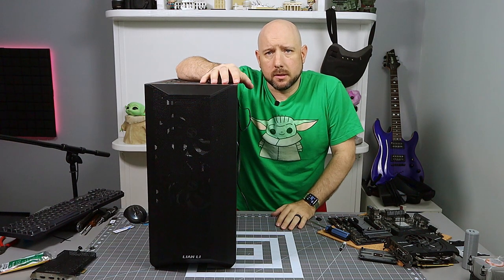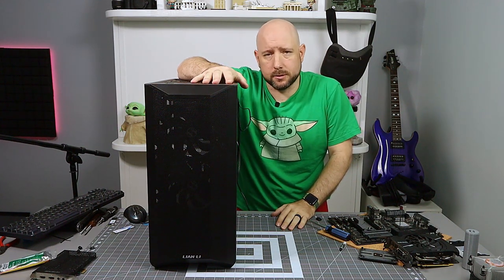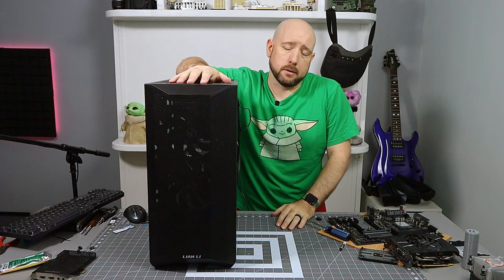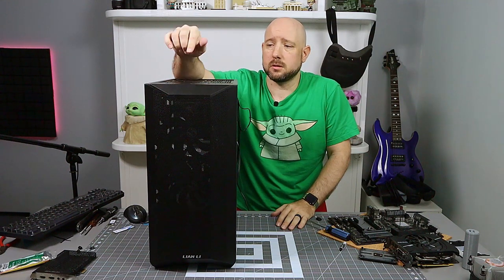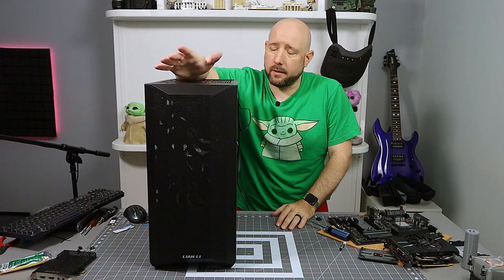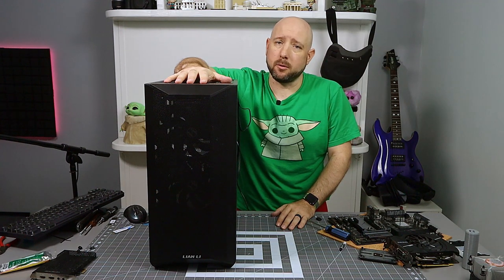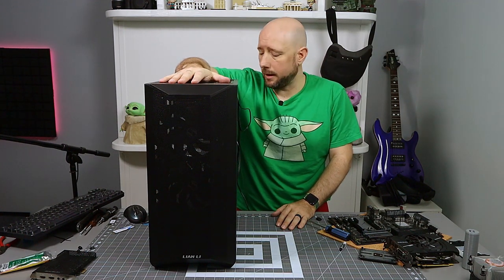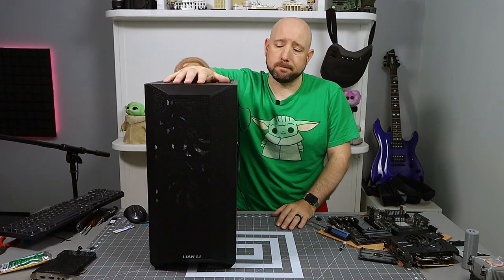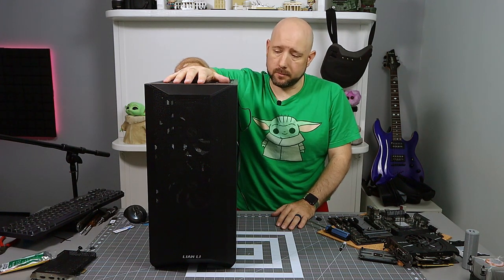So after hours of screwing around with different hardware, different BIOSes, replacing the CPU, replacing the GPU, pulling out the RAM, putting in different RAM, trying different video cards, I discovered that apparently the Aorus Elite X570 doesn't like HDMI. If I had HDMI plugged in, 1 in 1,000 times it would come up on the monitor, maybe 2 or 3 times I saw it total. If I have a DisplayPort plugged in, every single time it came up. So if you're having the same problem, don't use HDMI, use DisplayPort. I bet the thing works.